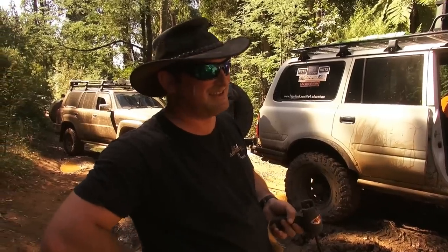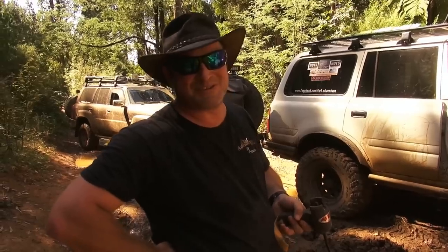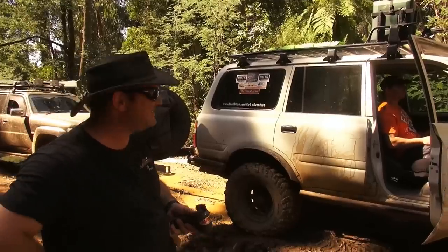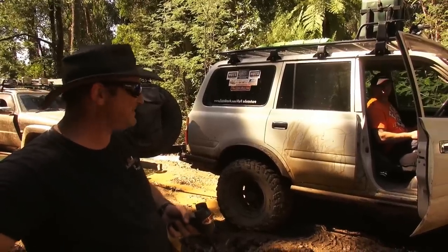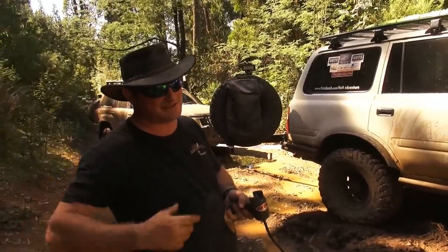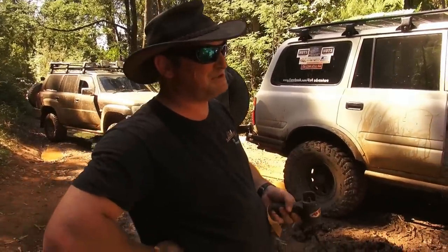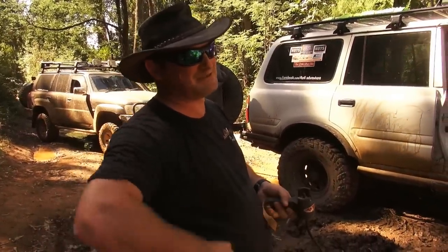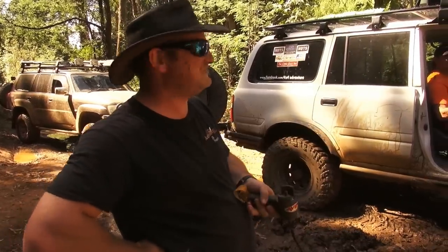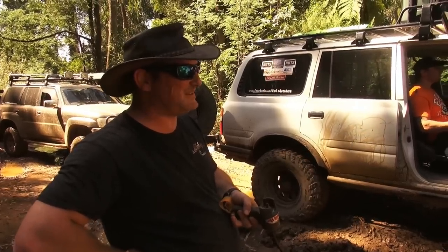He is. He is? But wrong line, that's all I can say. Yeah, seeing the handbrake doesn't work very well, so you always need someone on the foot brake when you're winching anyway. Especially when you're stuck in mud, because it creates a suction. So from a 2.5 ton car to being stuck on top of a mud ridge, you're probably pulling 4 to 6 ton? Double it.